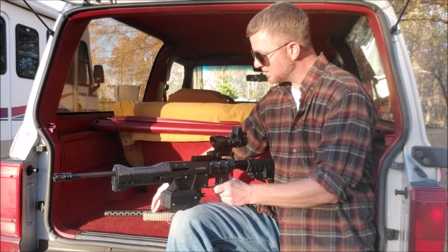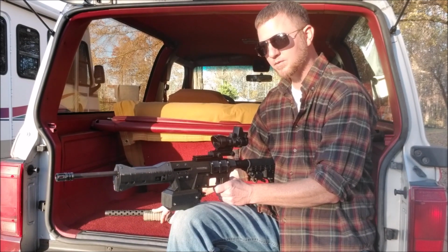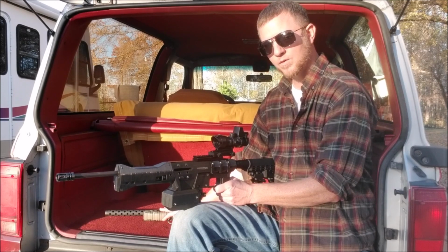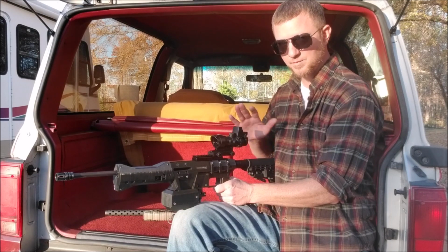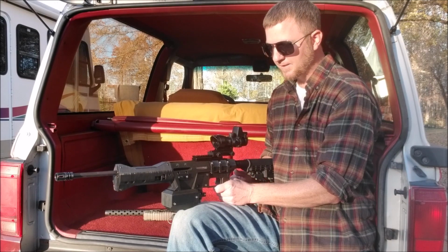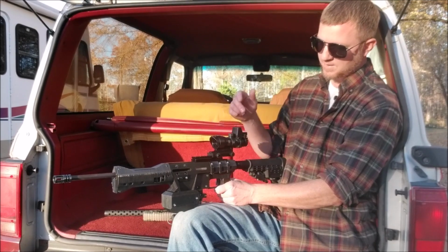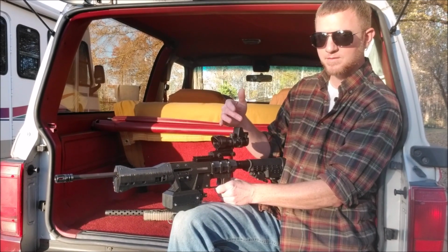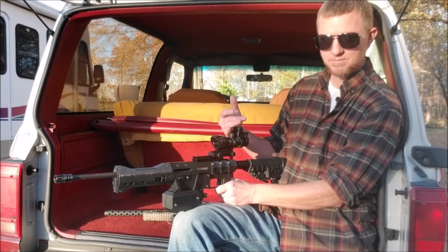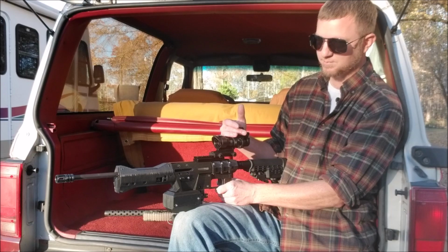But the ones that go into the Superbird are 9 amp burst capable. That means they're not going to be able to sustain 9 amps. I think they're 4 amp sustainable compared to 10 amp sustainable. And you really run into it, your current is very important with these systems, because you've got a motor in there and a solenoid, and they're both fighting for that current. So the voltage is important to a certain point, but if you don't have the current behind the voltage, you're just pissing in the wind.